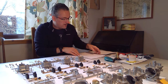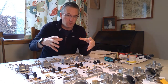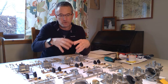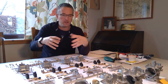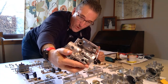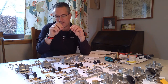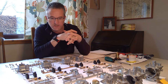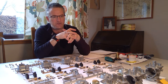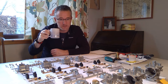Point three - cleaning. I'm lucky I have an ultrasonic cleaner. Clean off the outside using degreaser or brake cleaner before taking them apart, so you don't get grot inside. Put them through the ultrasonic and they'll come out clean but still really stained. The absolutely gorgeous option is soda blasting or vapor blasting - beautiful finish, doesn't damage the surface, fine lettering, or orifices. I got mine done by Andy at Sutton's Soda Blasting - cost about £90-100 including postage both ways, a birthday present to myself.